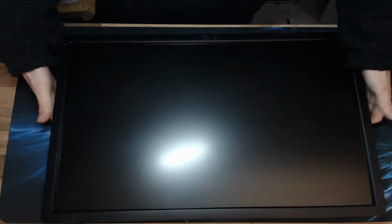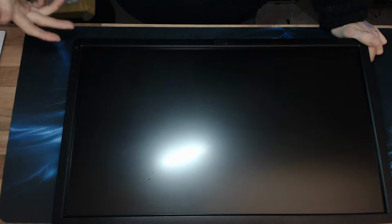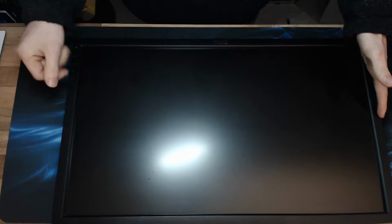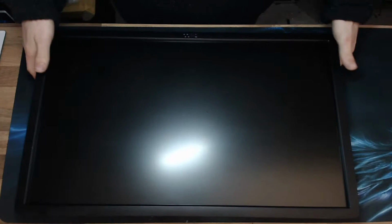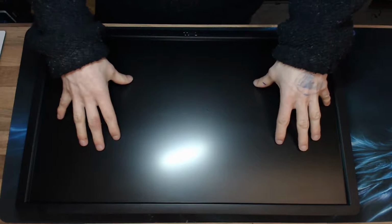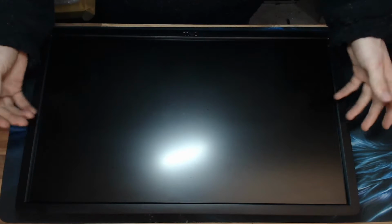And it usually manifests itself in a manner that the power light will be on, and it will often be blue or green or whatever and indicate that there is a signal, but the screen will be off. And in this instance the screen comes on and flashes for a split second and then cuts out again, but the light stays on blue, and the screen is detected by the computer and everything. So what's happening is that the main power supply to the display has failed, but there is still the sort of electronics controller circuit working. So the computer sees the screen, there's just no output.